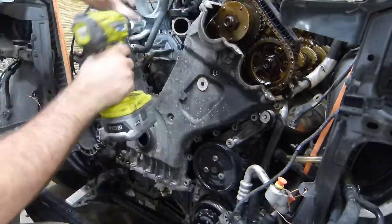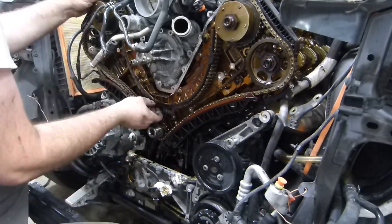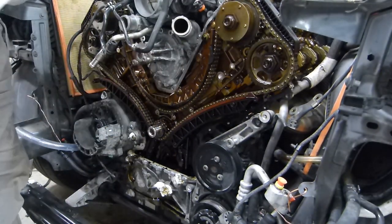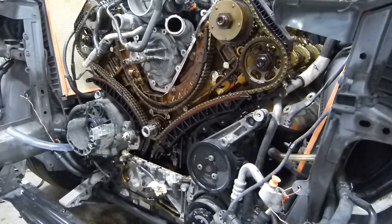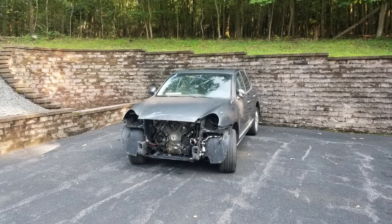Another tip: there's a stainless steel pipe — you'll see me bend it out of the way and then bend that tab out of the way. That's all you need to do to get the timing cover off. If you don't do that, you're not going to get the timing cover off and you'll have to take the plenum off instead — food for thought. I put the covers back on with just one bolt, made sure everything's plugged up, had a friend help push the car out so they can use the garage during the day, ordered parts, and pushed it back in. As of this point we're working on part two — see you there.